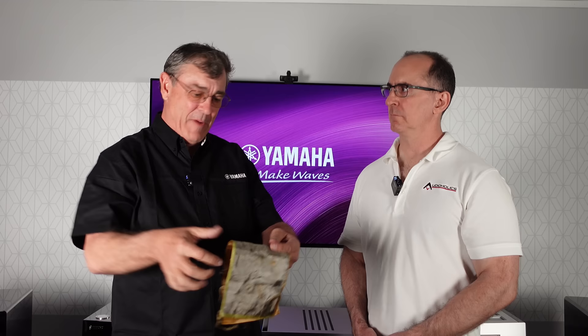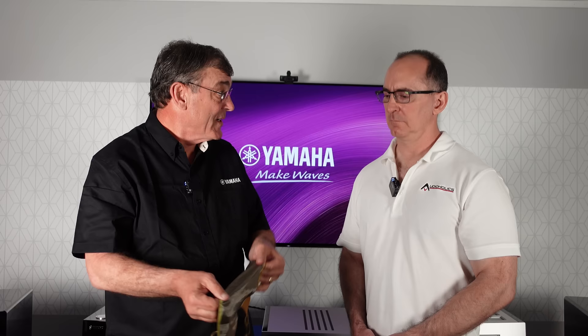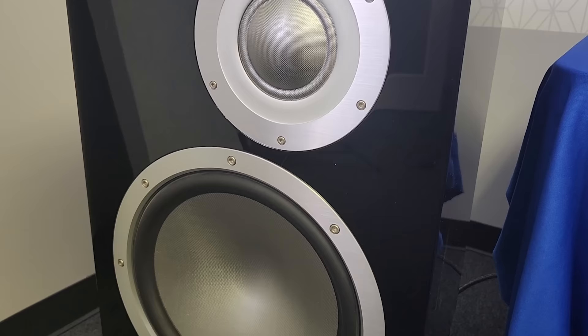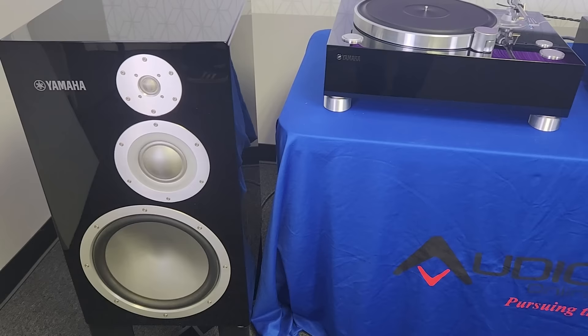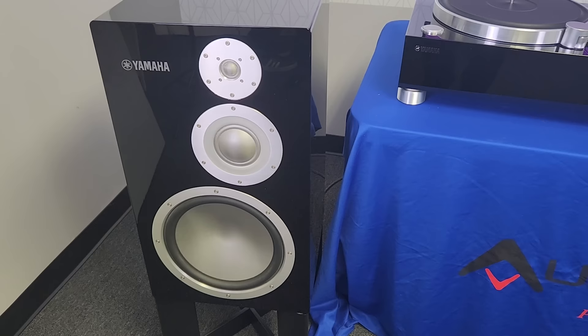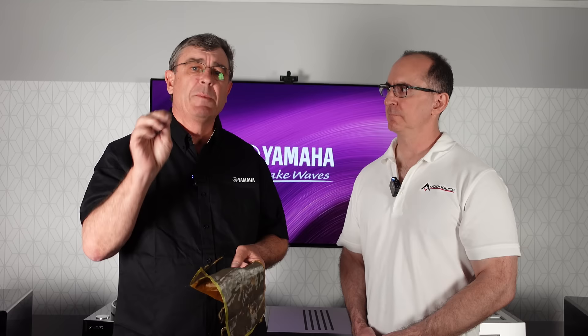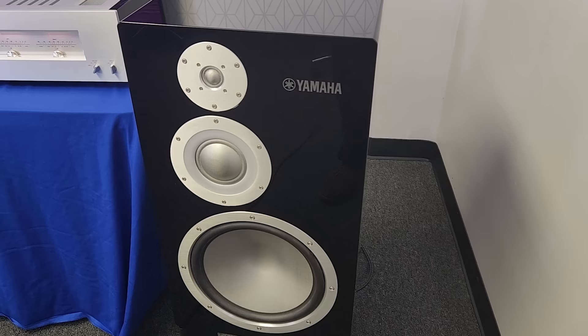You can pull Zylon diagonally but then you get wrinkles. So Yamaha had to develop an entirely new process — a heat-based forming method — to actually shape Zylon into domes. The reason Zylon was chosen is that it has almost the same sonic qualities as beryllium in terms of speed and damping. You want a speaker material that is lively but doesn't ring on its own — Zylon is extremely close to beryllium in those properties.